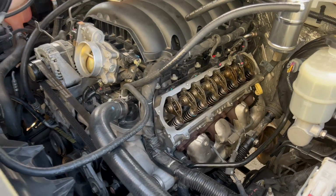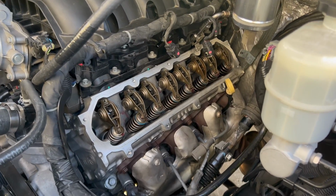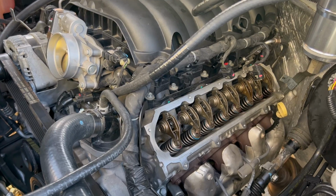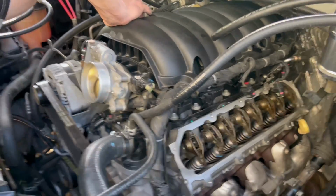All right, guys, so it's the next few days, and finally got our push rods in. Second set, Austin, right? Yep. So GPI sent us a 7.85 push rod initially, which are the exact same length as the factory ones, which are too long for our setup. So sent them back, got the correct ones that we wanted, which were 7.800, which left us at, I guess you can call it, a perfect 1 1/4 turn. So our preload is right where we want it.